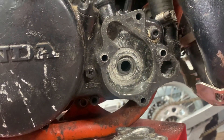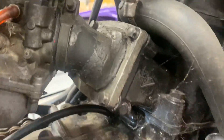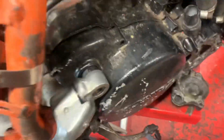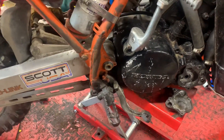I have done that myself in the past. One other thing to notice is all of the engine appears to have been painted, the front pipe has been painted, there's a dent in the front pipe and dents down near the front. The inlet manifold is all cracked. It does turn over, but the clutch cover moves as you turn it, so I'm not going to do too much of that.